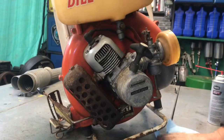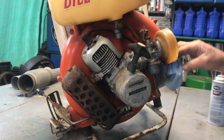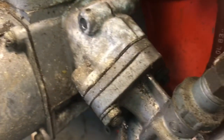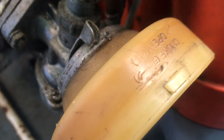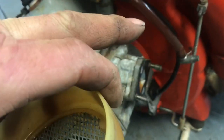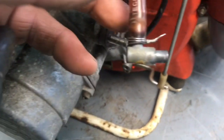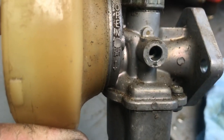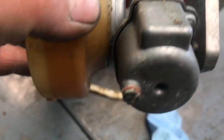I'm going to get this carburetor off — I'll stop the camera for that. All it is: take the throttle linkage off and there's like two 10-millimeter nuts right there. Take the carburetor off, take it apart, see what it looks like. So we got the carburetor off and the fuel line — the whole fitting came out of the side of the carburetor. Hopefully when I put that back together it doesn't leak.